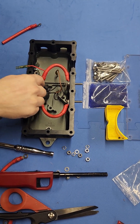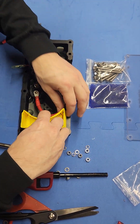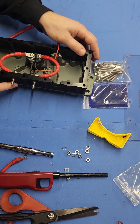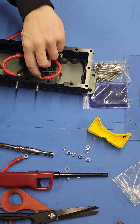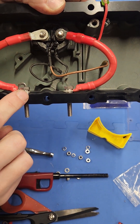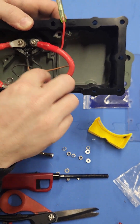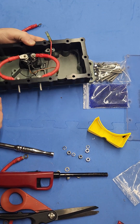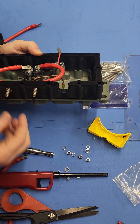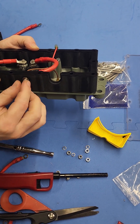You can also put this wire the other way, but I like to do it like this. You'll notice that this box actually has a cutaway to allow that wire. On this side, we've got the bolt, a lock washer, the battery lug, and then a flat washer — it holds that battery terminal just nicely off of it so you've got a little room for the heat shrink. It's a really nice slim setup. You could also put a cap over this to cover it. Go ahead and put a flat washer on next, and you can apply a little 1211 in here if you really want to make sure it's sealed.